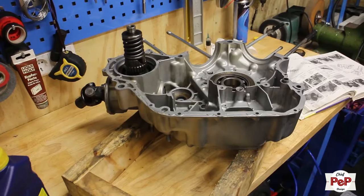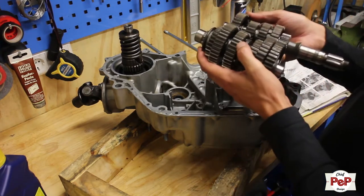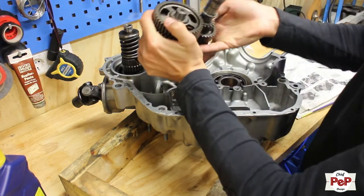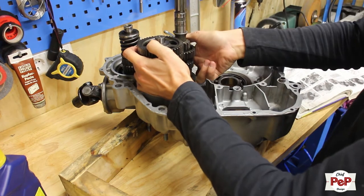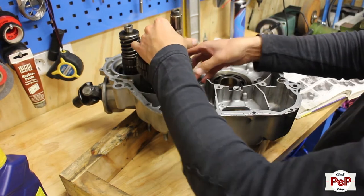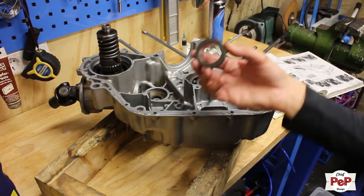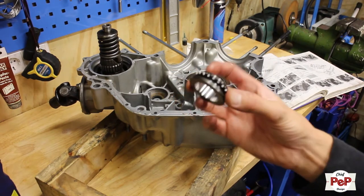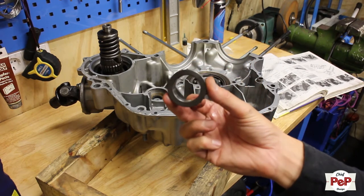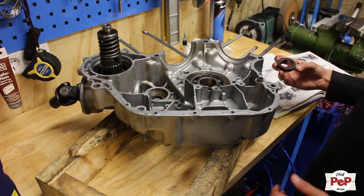I always test fit things before installing them permanently, and to understand the workshop manual better it's good to see what you're going to do. These are the two gearbox shafts that will fit like this. Notice my crankshaft isn't yet in place because it's in the freezer, which should be the case before you start this assembly — this is only for test fitting. This is the oil gear which goes on the crankshaft after the crankshaft is installed. It's a really horrible gear to get off and to mount, as I know from experience. It's impossible to get it off without the best puller you can find, and nearly impossible to get it on without a hydraulic press and a good fitting tube of some kind.